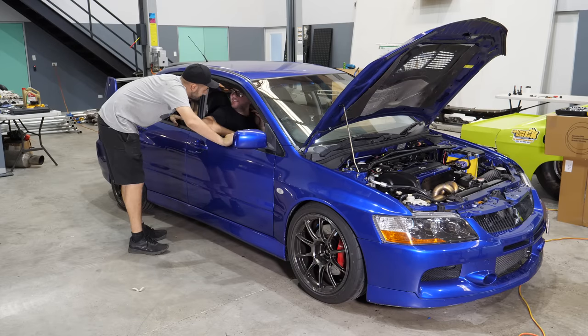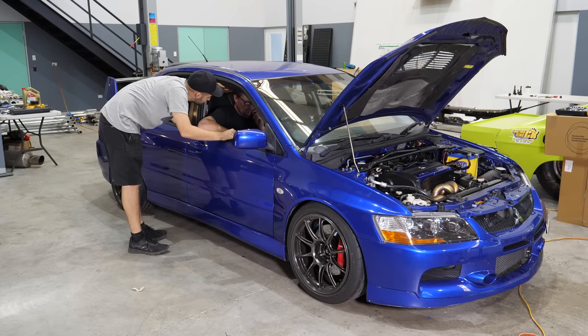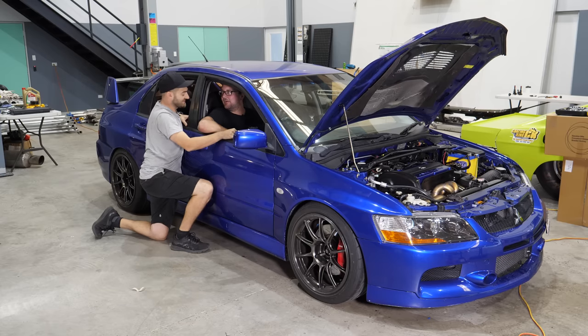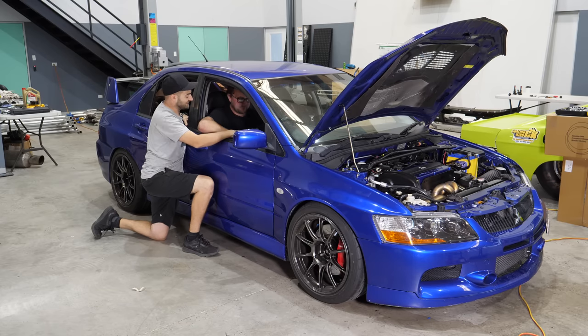Is it time, Scott? You ready, mate? Is this your Evo, Matt? No. I wish. Nah, because mine was a 2.4. Oh, of course. So the ignition map was heaps different. So you've got the 4G63 base map type thing. Base map, and then I'll start from that and then just go and massage it to suit this particular car. So it's not starting from the very beginning because it would take forever.